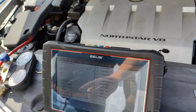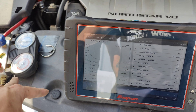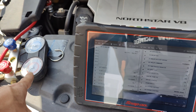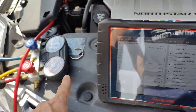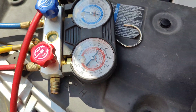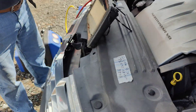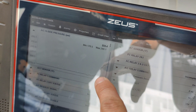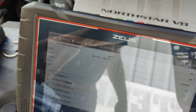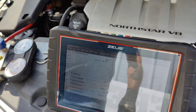I found it on a diagram — these will end up within about 10 psi of each other once pressure bleeds over. You can see how it goes up because the high side should match and be really close, which they are — right around 172 and 175 or so. Then if I start it back up, you'll see that one shoot way high on the scan tool, up to like 300. Yeah, I see it jump to 240 and this is dropping. They should stay the same — close enough. This will end up coming back down with the fans.